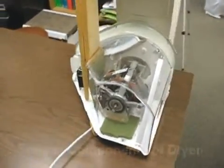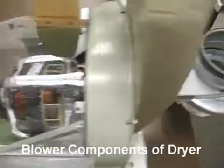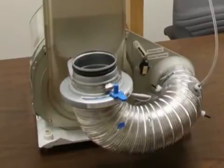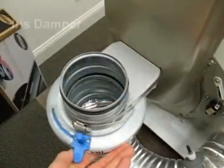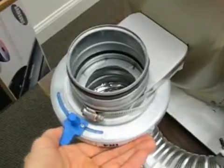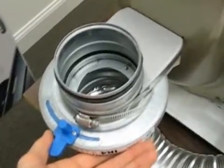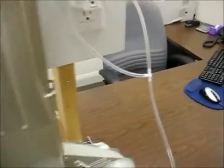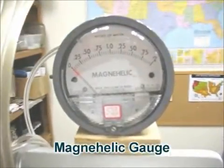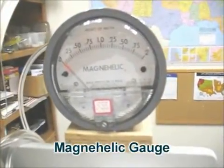To minimize its footprint, we will only be dealing with the core components of the dryer's exhaust system. Here we've added a typical flex transition hose connected to an iris-style damper that we'll use to simulate lint buildup by closing down the aperture or choking the airflow. Here we've teed off the tubing to display the analog pressure levels with an industry-standard magna-helic gauge that quickly indicates low air pressures up to two water column inches.